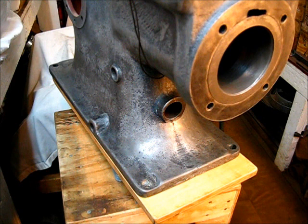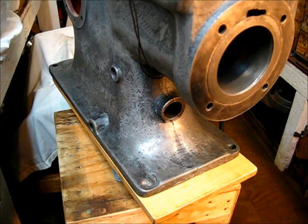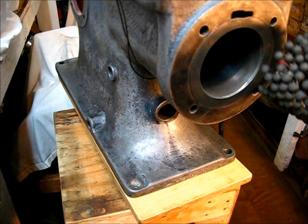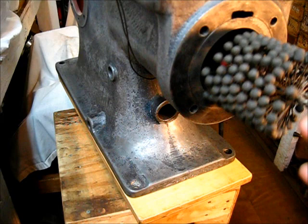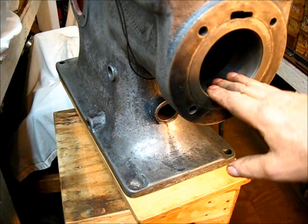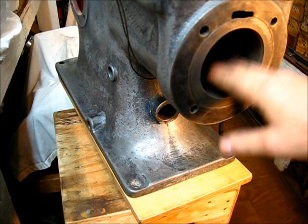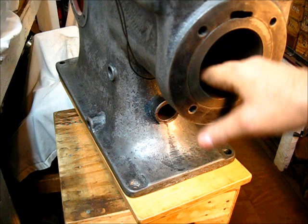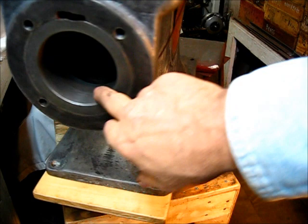Just your regular old quarter-inch drill — electric in this case — and as you can see, it's slightly too big for the bore. When you're honing a cylinder, if it takes any more than just a very short time, all you're doing here is breaking the glaze. That's all you can do with this type of equipment: break the glaze and leave it with a crosshatch pattern to give your rings something to wear to.